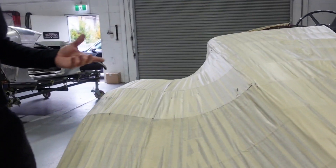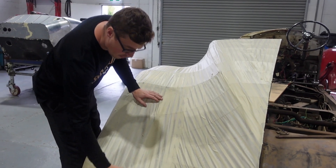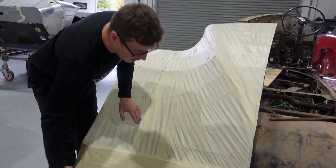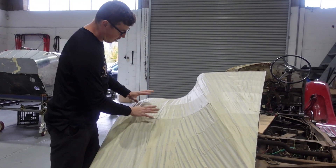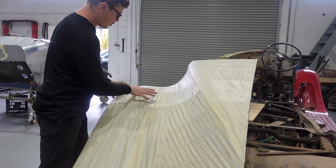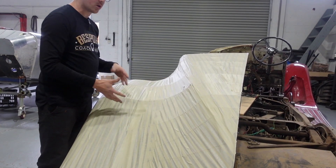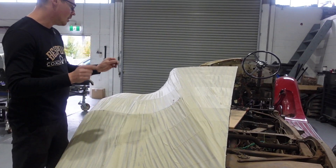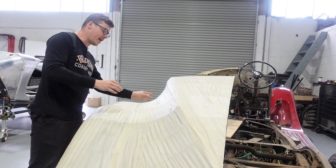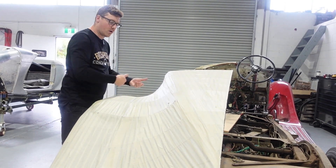From then on I just started to run another hard profile through here and another hard one along the bottom here. That gave me roughly where the edge of the transition between the guard and the quarter panel would start. So if there is going to be a parting line, it's going to be around that space. I wanted to dictate what that inner edge was going to be — where this reverse would sort of flow down into and then turn into its compound curve.